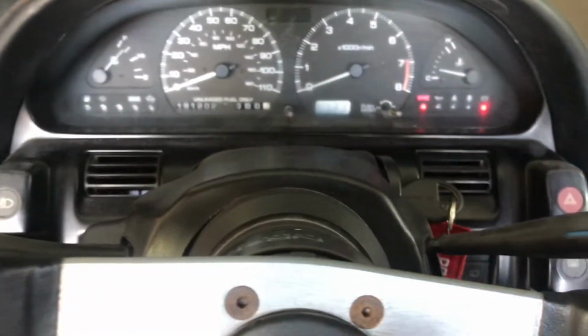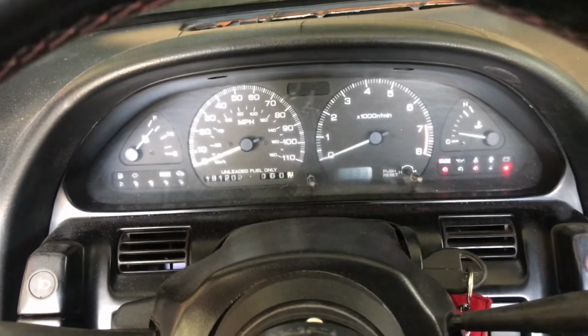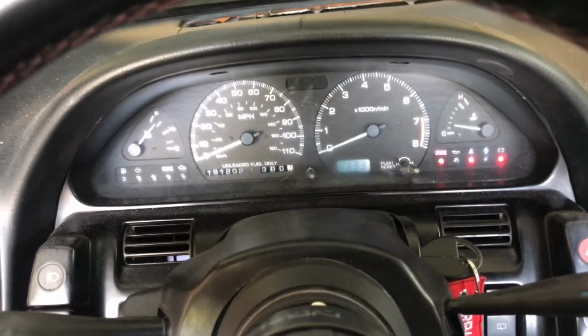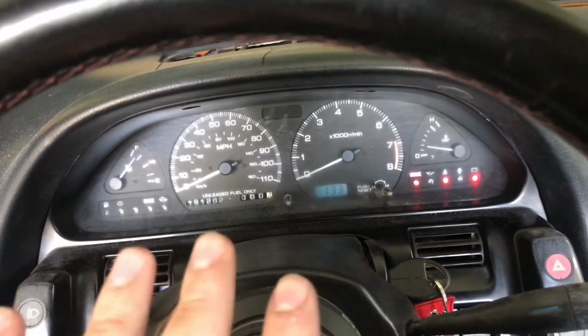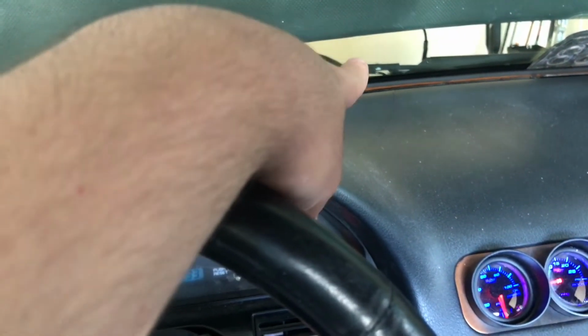Then you're gonna go full throttle. So your gas pedal, your throttle, you're gonna push it all the way down. Okay? Then we're gonna crank it a few times. That should be good. You only want to do about 3 to 5 revolutions. I went a little extra just to make sure because I can't see the gauge over there. So now we're gonna test the pressure on cylinder number 1.